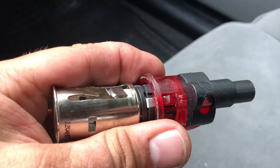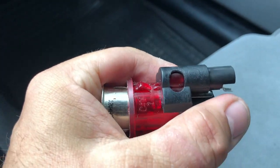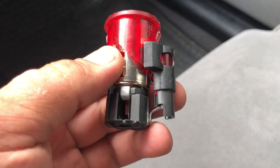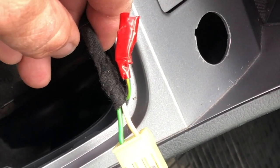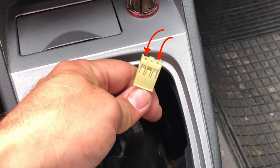Actually it's not too hard to put it back together after that either. I actually did it with one hand like I'm showing here, but of course it's easier with two hands. After that everything was easy. The socket actually had three cables but I only needed two of them — plus and minus — and luckily the socket connected beautifully to my new USB port. So I just had to rearrange the cables a little bit: I took them all out and put one on the left and one on the right for plus and minus, and the third cable I didn't need so I just isolated it and tucked it away.